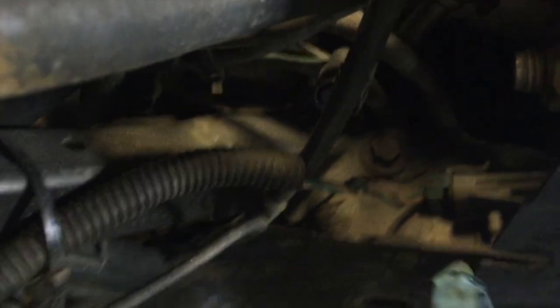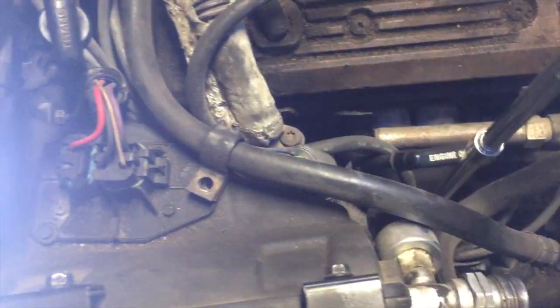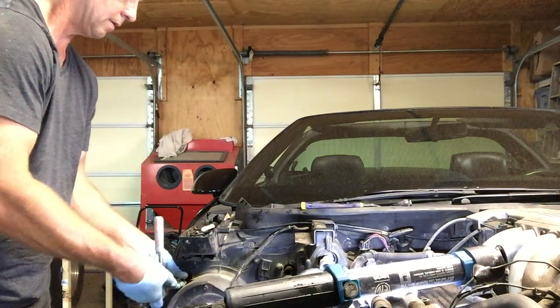You have to take the bolts out of the top of this support bar and then follow it down. There are 3 bolts on the frame itself, 2 on top and 1 on the side. The 2 on top are pretty easy to get to with an extension from the top. The 1 on the side is a pill. As you can see in this freeze frame, the bolt's out in this shot, but you can see where it was. I ended up taking a ratchet wrench, duct taping it to a screwdriver, and using that to get it out. Hillbilly ingenuity there. But I did get it out.